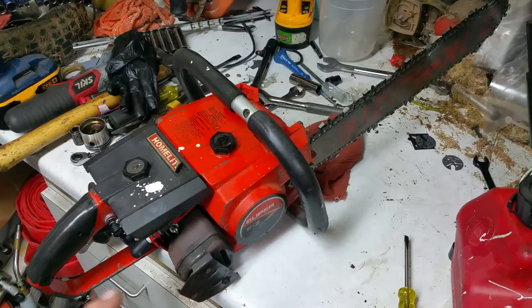You got to keep these things clean and you got to keep them tuned correctly. Again, it goes back to the operator always listening to their saw, because if this saw starts running lean, it's done. It's on the edge of being performance, but it's a fun saw to run. Hence the reason why now I have three. I would say probably in not even a full tank of gas, I'll be tuning this thing constantly to keep it running perfect. So yeah, there you go.